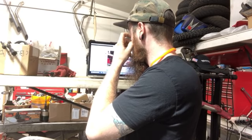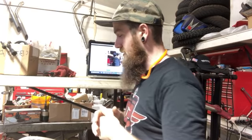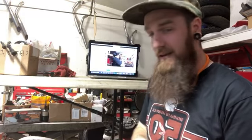Sarmika, how often do you rebuild top ends in your shop? Lately, I've done a lot. I did a CB550F about 4 months ago. I did this one past month, a 78 CB750F with an 836 big bore kit in it. Whoever installed the kit didn't make sure that the oil passages were clear and completely seized the left side of his camshaft. So I had to rebuild that. That was as of recent, past 2 months.